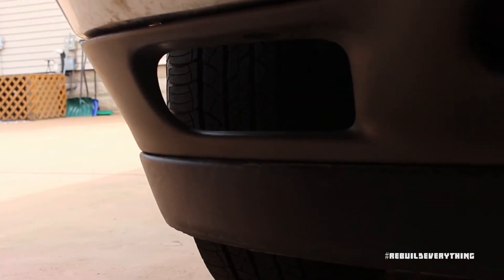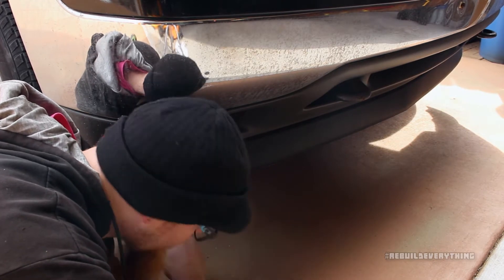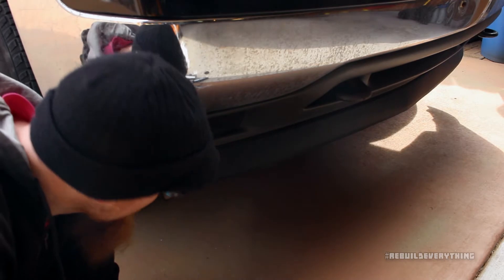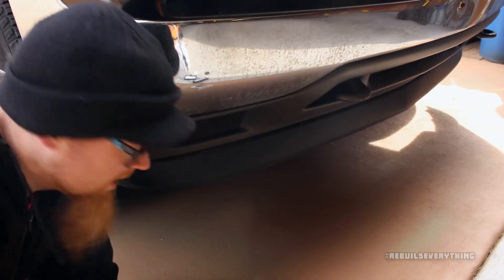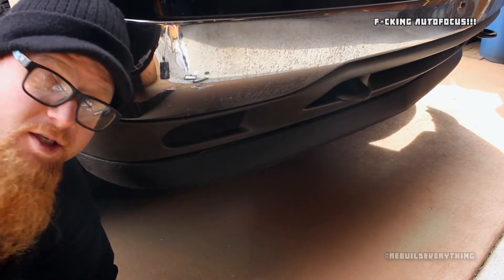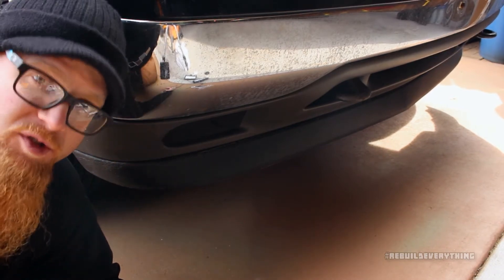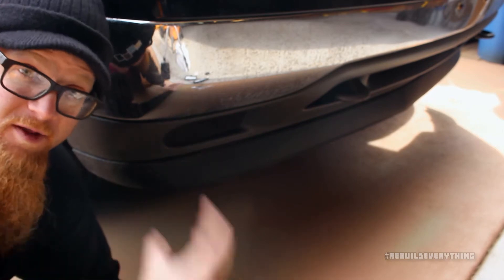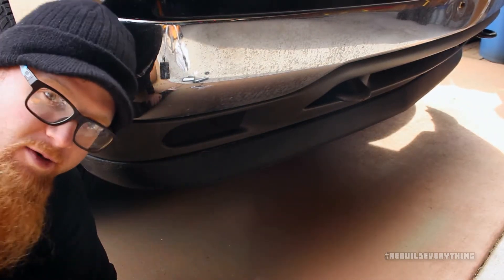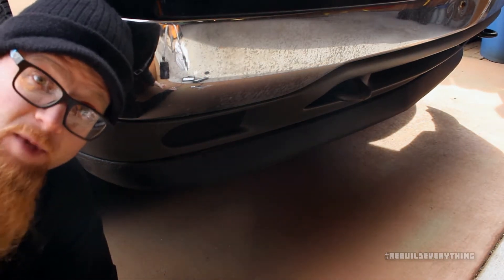On this side, we've just got the opening over here. If we zoom in on the bracket, you can see it is just a square chunk of sheet that at one point had a coat of paint on it. It's got a hole drilled in it the size of the single mounting screw coming out of the top of the bracket. The other side has two screws that go through existing bolt holes where the old plastic bracket went through. If you guys were to make your own brackets, you can definitely do it the same way using the existing hardware holes from the stock bracket, or you can just drill a couple new holes. There's plenty of places on the backside of this valence and the lower tab of the bumper. These aren't super heavy — maybe a couple pounds each — and that piece of sheet should be enough to hold them. You could put a bead in the middle of it with a bead roller to stiffen it up if you went with a heavier light.